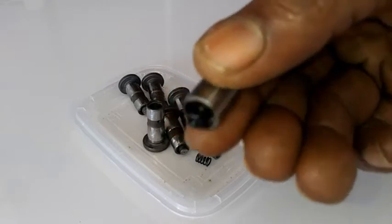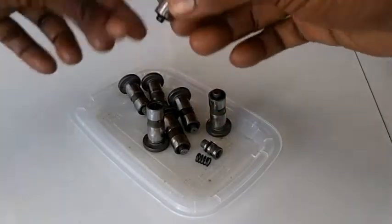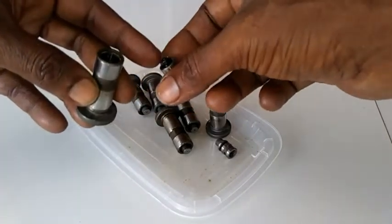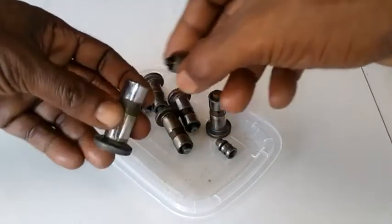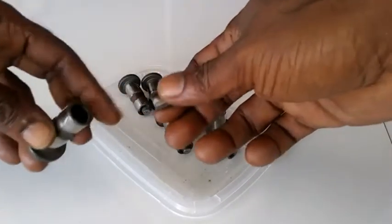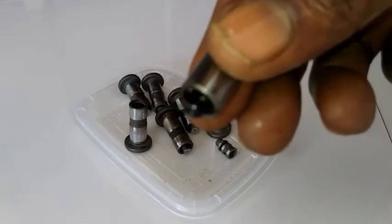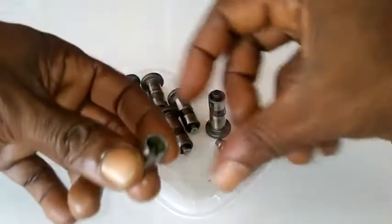You're going to see that there are two holes on the bottom here. What happens is, when this plunger has to sit with this spring inside this lifter body, at 180,000 to 200,000 miles, this area down here and at the bottom of the body inside of the bore will develop sludge and carbon. And that's going to block that passageway right there and prevent oil flow into this compartment.